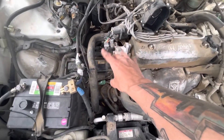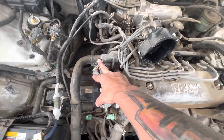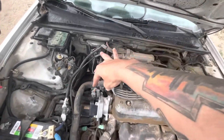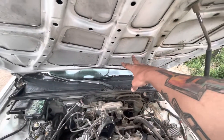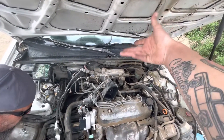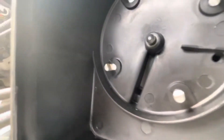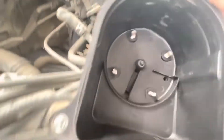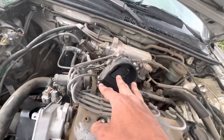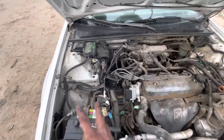So we took apart the distributor. We're also gonna check this little yellow wire, see if we got 12 volts with the key on, because that'll make sure the little key switch on the inside is good and bringing power out here. I did that years ago — you'd think it wouldn't be dead, but cheap parts end up failing. Also, in here there is some massive corrosion, so we're gonna give that the wire wheel. Give that a shot, and hopefully something. I think we've come up with a solution.